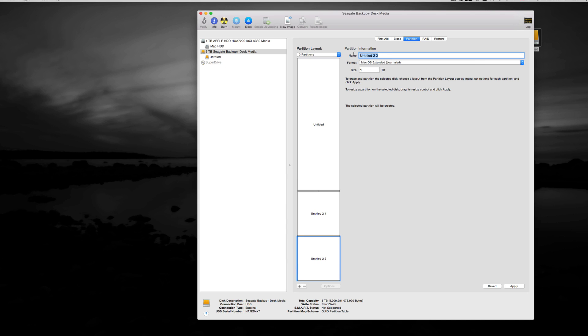If you plug it into a PC, only that exFAT partition will show up and you can share files through it. If you don't need that, just format as Journaled. From here you can name each partition — this one will be for my pictures so I'll call it 'Photos.' My second partition is a major backup so I'll name it 'Backup All.' The third one I'll leave for Time Machine for now. Don't worry if you change your mind — you can always redo this, though you will lose the files currently on the drive. Press Apply.